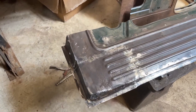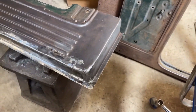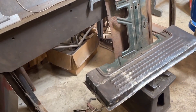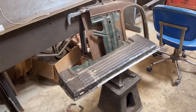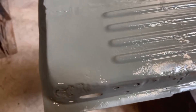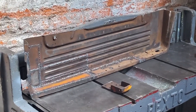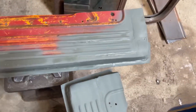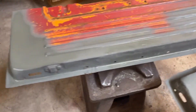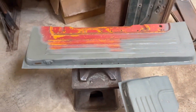Check this thing out — knocked all these welds down, got everything smoothed up. It's not perfect but it's where it needs to be for this next step. I'm going to get a little bit of primer on this thing so it doesn't rust again. Always love this part — it does two things: it'll keep the part from rusting any further, and it shows all the little imperfections much more obviously where I need to tune things up. Not too bad. You can see there's a seam right along here — there's that corner seam where it wraps up. This is new, this is new, all this is new within the last day or so. That whole flange is brand new, and this hasn't even gotten any kind of body filler — which will only need a little bit because it's all metal.